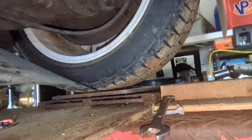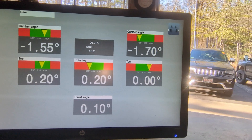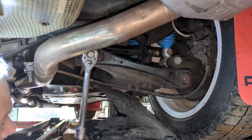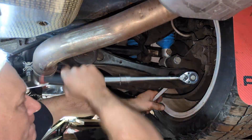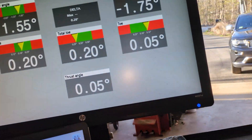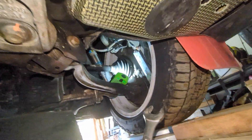You can see I was at 2.10. By loosening this with the wheel in the air and no weight, I dropped to 1.70, which is much closer to spec — at least I'm within spec. After tightening, I'm back at 1.75, which is still better than my 2.10 and way more within spec.